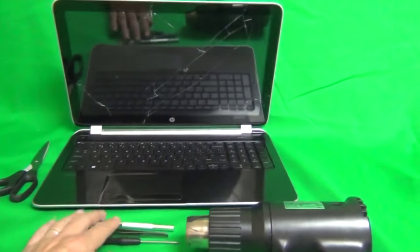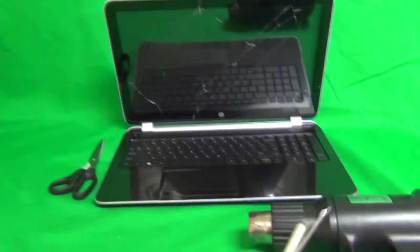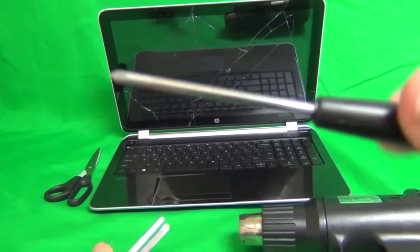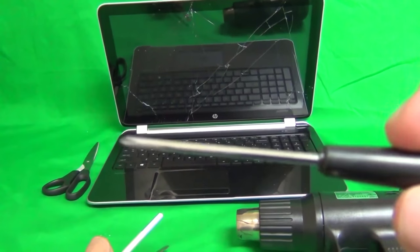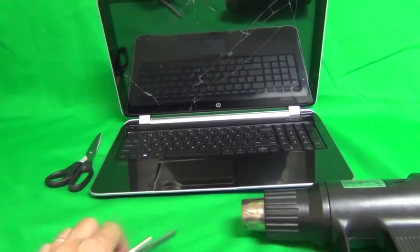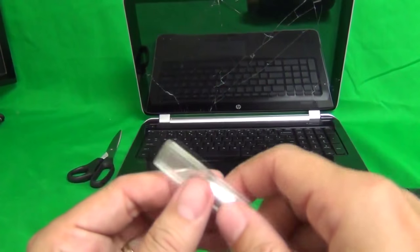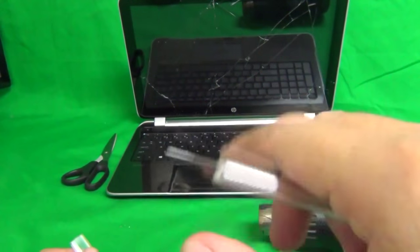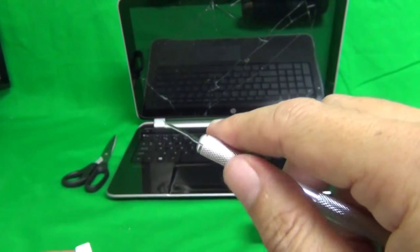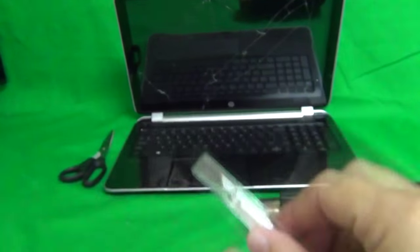Okay, so let's start with the tools we're going to use because we have more than usual for this procedure. We have a PH0 Phillips electronics screwdriver. PH stands for Phillips, and 0 is the size. We have a pair of metal tweezers to manipulate cables, and we have a hobby knife or X-Acto knife with a pointed end, and that is used to pry open the touchscreen digitizer panel and also to lift up adhesive